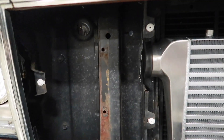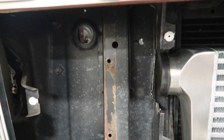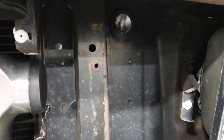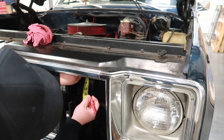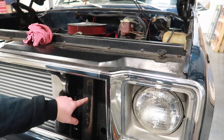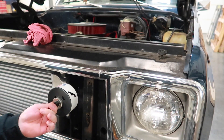Okay, it's day two here on the intercooler project. I went to the hardware store and got a four inch hole saw, so now I'm going to cut the two holes for the inlet and the outlet in the radiator core support. I'm going to measure down two and a quarter inches from the top of this hole to the center — that's where I'm going to drill my four inch hole, and I'm going to do that on both sides. Since I'm using a four inch hole saw, if I go down two and a quarter inches that's going to leave me enough room to still use this hole for the mounting bracket for the top of the intercooler support. I'm going to pre-drill this out with a different bit and then use the four inch hole saw to make the hole through this bracket and through the core support.